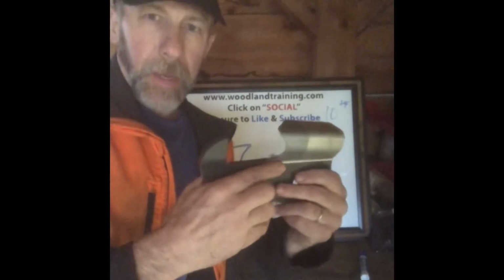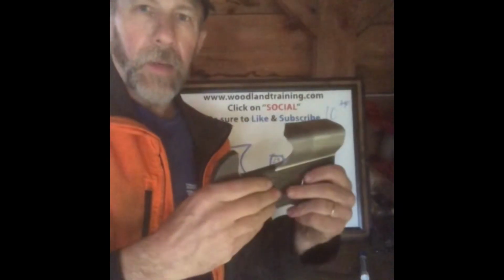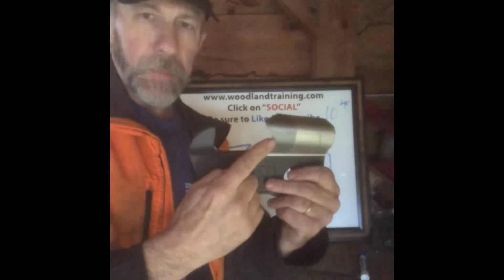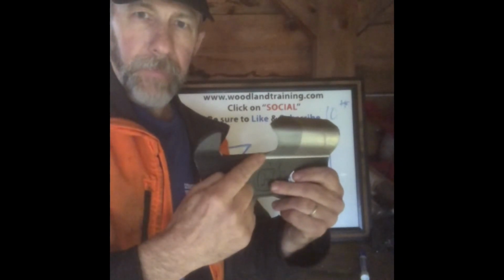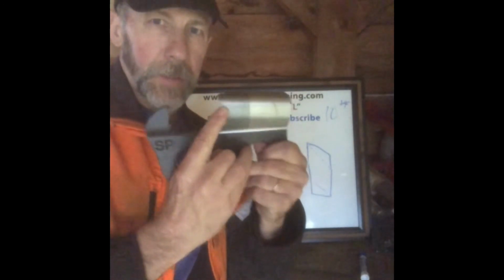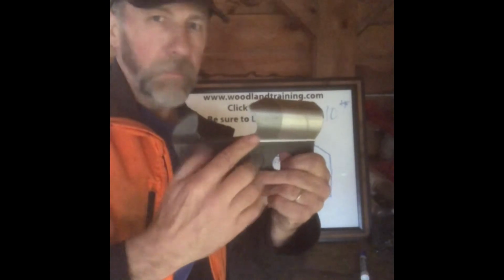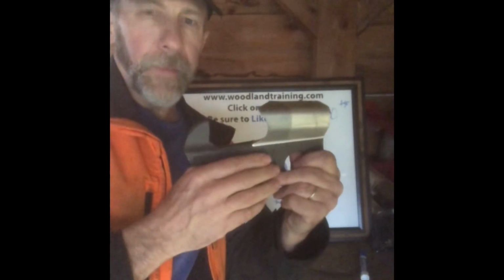Reducing a lot of drag, because all of those teeth, both sides, all the way through the middle of that log, that side plate is rubbing on that curve. Let's bevel it in just a little bit. So we get rid of that metal, right? Reduce that drag, but don't dull the top of your top plate. That guy's still got to be sharp. That's cutting your wood. But the bottom, say bottom 3/4 of your tooth, that's not doing anything. Let's bevel it in, get rid of that drag.